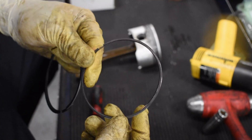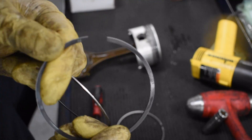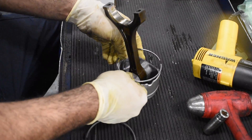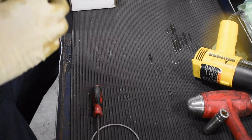Here are some new rings. Each ring has its own designated position. The bottom ring is the oil scraper ring — it sits in the third slot on the piston head. The 2E sits in the second groove. The 1E sits in the top groove.